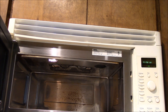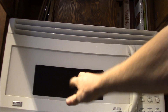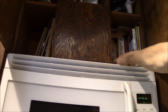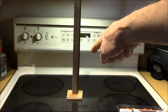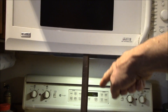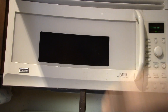Unfortunately, this 500-watt bulb is way back in the unit, so you have to take the whole oven out and remove the top cover to replace it. The oven mounts on a plate on the back wall with clips or a hanger for the back, and two screws through the bottom of the cabinet hold up the front. When taking it down, you really need something to hold up the front while removing those screws — otherwise it'll drop like a rock. Cut a piece of wood that just barely fits and wedge it underneath the front.